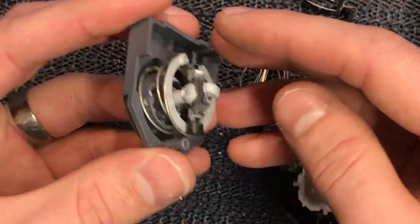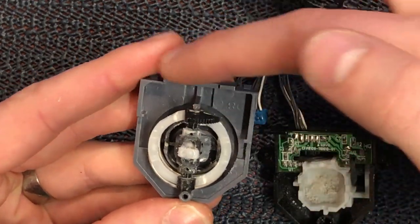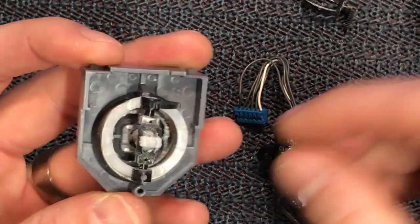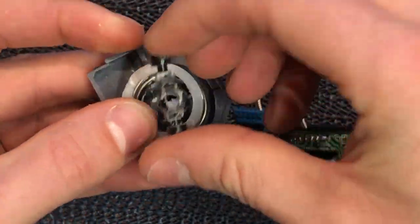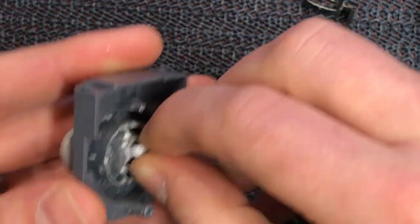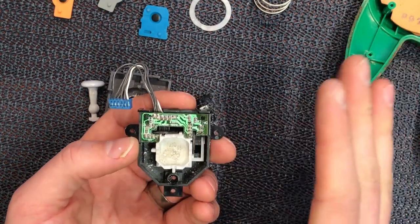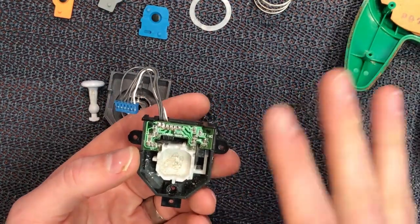Before you completely dismantle the top side, take note of which way it all sits. The gear itself is towards the flat rear edge, not the front. This piece is horizontal so it locks in place. The white ring is on top of the spring and the spring just sits on top. Now pull it apart — rotate that center piece, the ring will come out, the spring will come out, and the joystick if you rotate it will pull right through the whole plastic case so we can give it a proper clean. You'd be tempted to blow all that white plastic out right now but don't — it's going to go everywhere. Really need to take it and wash it out.